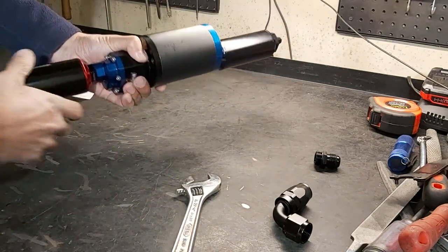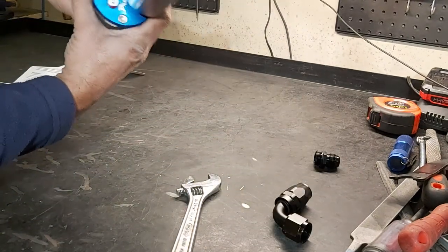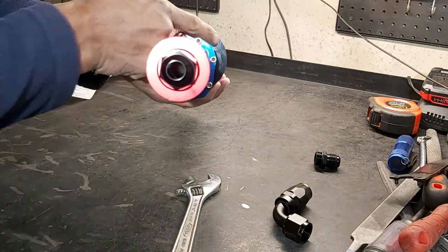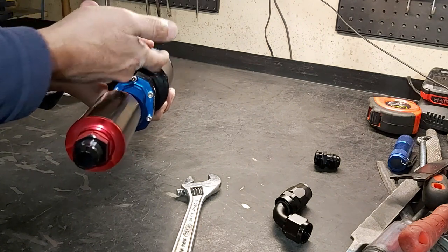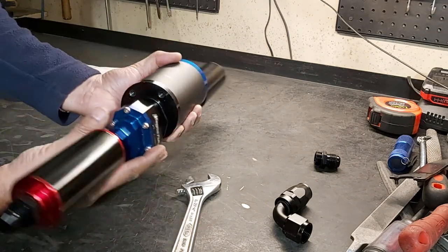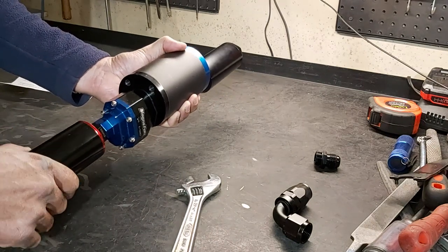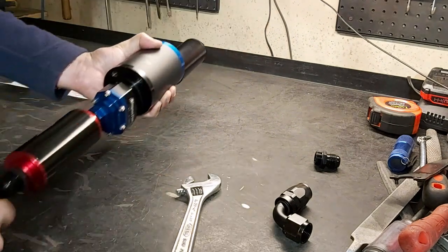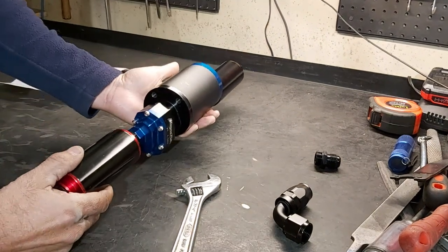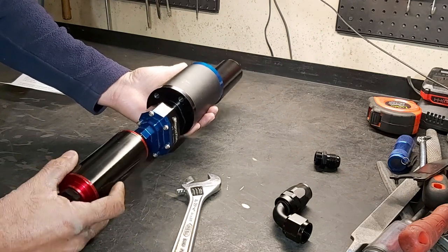The line and filter will be under the car mounted to the bracket. The braided steel fuel lines — the number 6 and the number 10 — will actually support the assembly from the fully welded bracket, so it'll be pretty rigid.